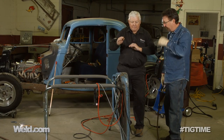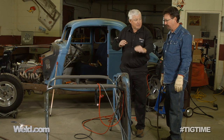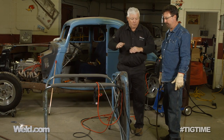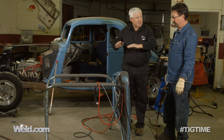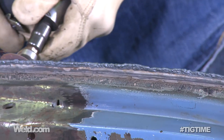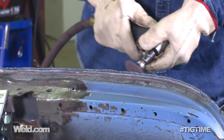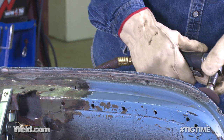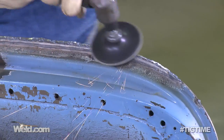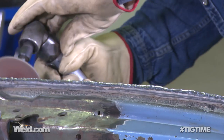What I did was I laid down a very fine, consistent weld bead, but it didn't have a lot of build up to it. Then I did a second pass, and then a third pass. Now, each pass the weld starts wavering a little bit, so I need you to just knock off the tops and establish the line again. What you're doing is helping the guy that's going to do the body and fender work and ultimately paint it — so if there's anybody to get yelled at, we want it to be you. The more we can get it closer, the less it's going to cost us to get the final product done.